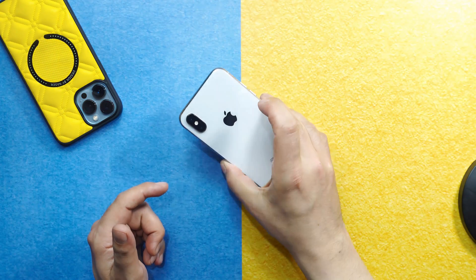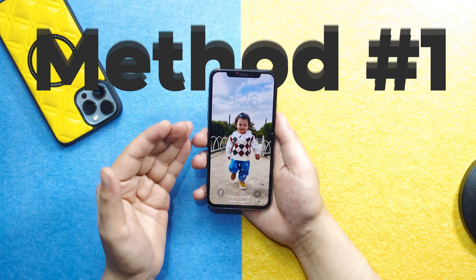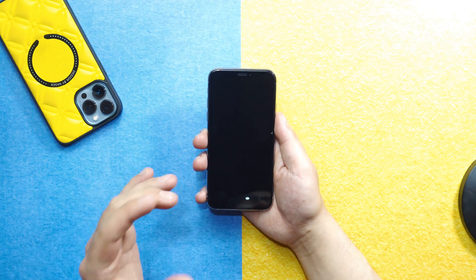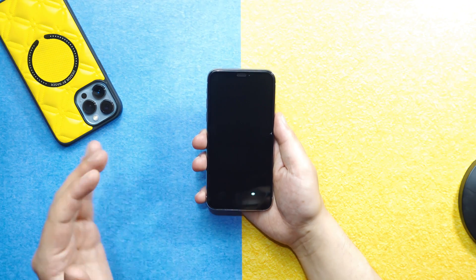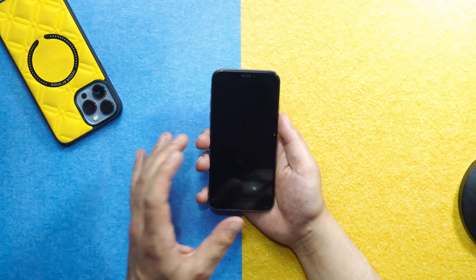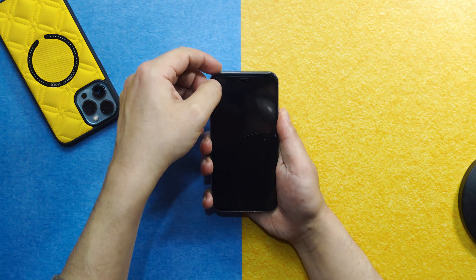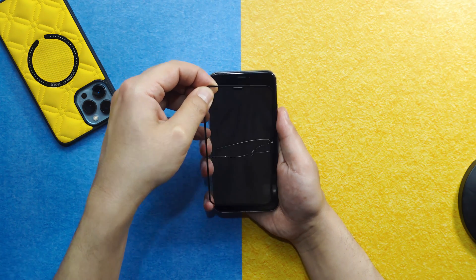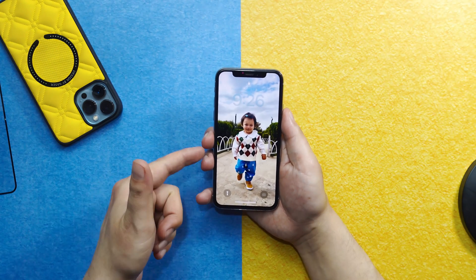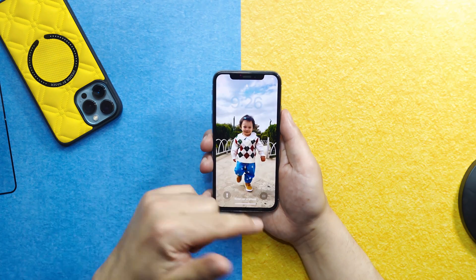As you can see, I have an iPhone X which is unresponsive to touch. Our first method is removing the screen protector. Sometimes we install a cheap and very thick screen protector that causes many problems, and one of which is the touchscreen not working problem. So try to remove your screen protector and see if it helps.